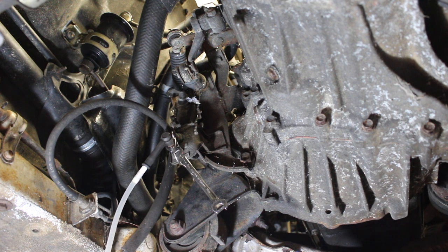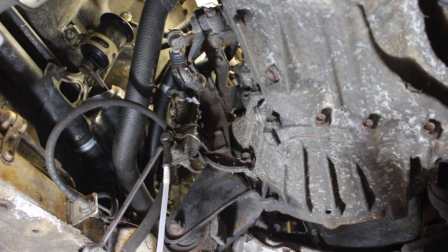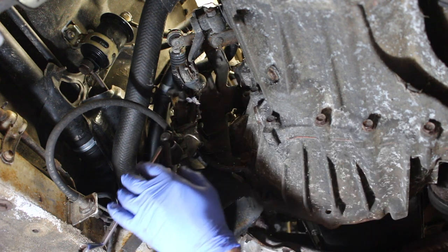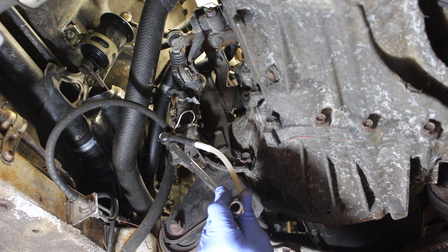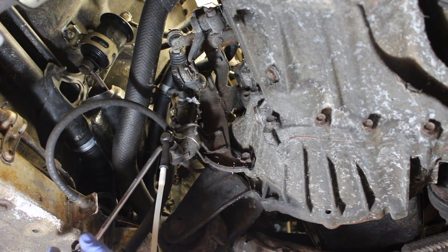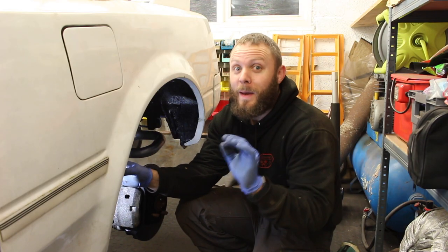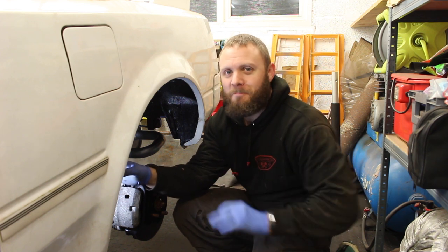Moment of truth — oh what a dream, look at that! Very mucky, very aerated. I'm noticing that when I let go of the trigger it pushes back up, so we're going to have to keep sucking as we're shutting the nipple. That is making my life a hell of a lot easier. Let's go check the fluid level at the reservoir, top it up, and go again. We crack the nipple open, suck a load of fluid out, and shut it as we're sucking. Result — that's the clutch done! That clutch feels amazing now, the feel is back and it seems to be operating nicely. This new tool is doing the business.